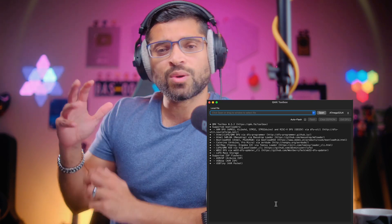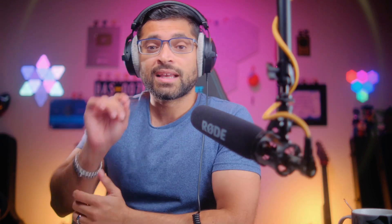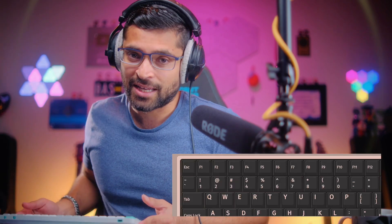There are a few more things I want to mention about this keyboard. First, I really like the feet — it gives me a very nice typing angle. I did have to update the firmware in order to use it with the VIA app, and to update the firmware you need to use the QMK Toolbox, which works on Mac as well as Windows — I actually used it on my Silicon Mac. Additionally, in order to use the function keys without having to press the Fn button, I had to remap them using the VIA app.